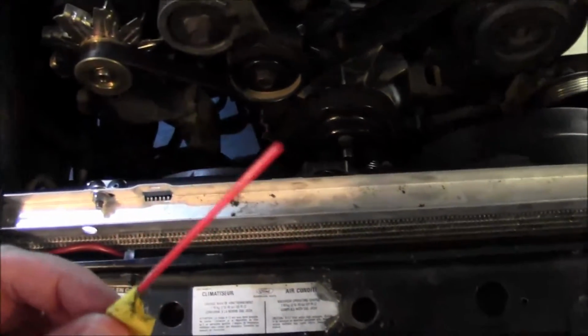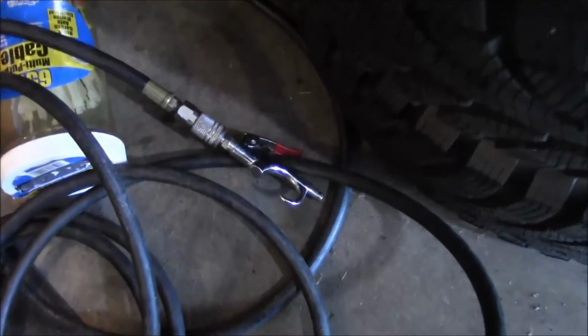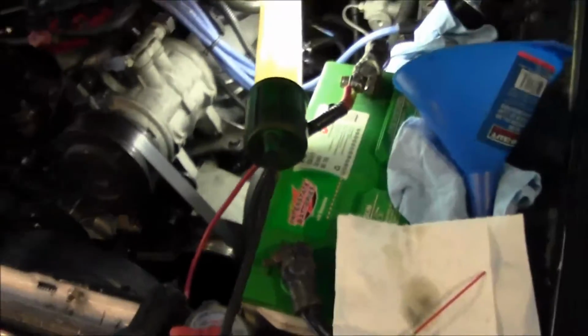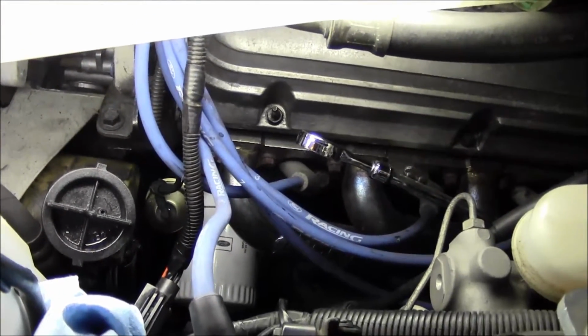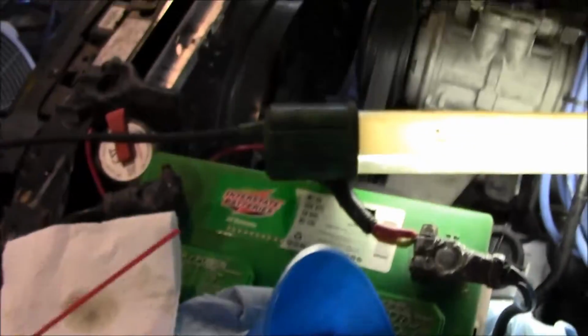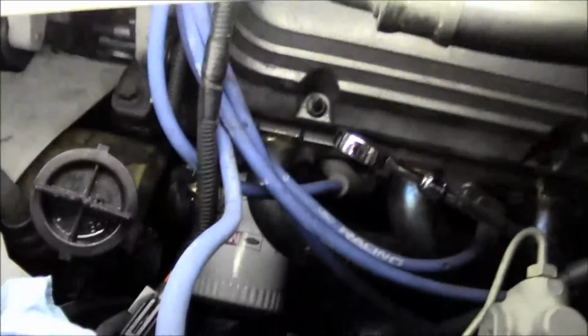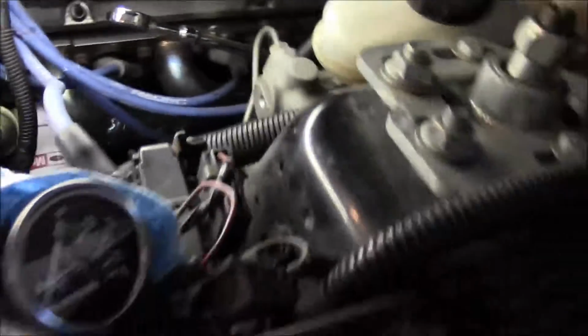I didn't really get any kind of doo-doo chunks out of there. And then I took compressed air and started blowing some air in there. So I think that passage seems like it's open. And it doesn't seem like the engine's losing oil pressure, because I would expect the lifters to start clacking real bad and all that. So anyways, after I probed that thing out, I thought, well, I'm going to put the factory sender back on there instead of this gauge. So I did that, and I thought, I'm also just going to swap the filter. So I took that filter off.